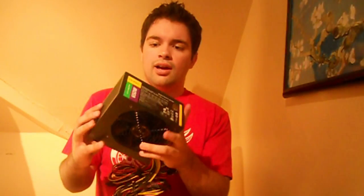You might be able to run two 6850s or something like that with 650 watts. One thing you really want to make sure of is that your power supply is 80 Plus certified. This one is 80 Plus Bronze. You can also get Silver, Gold, and Platinum — those just mean they're more efficient under load. That's the problem with using a 1,000-watt power supply when you're not using all that power: it's less efficient and can actually shorten the life of your power supply. So you want to get the right wattage you need. There are lots of calculators on Newegg or Tom's Hardware — just add up what your processor and video cards need and make sure it's good. I went with 650, which is going to be plenty.